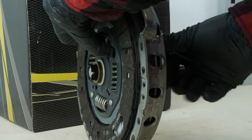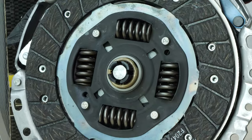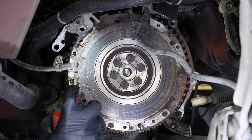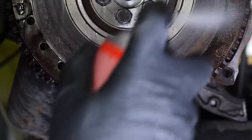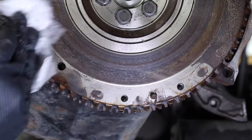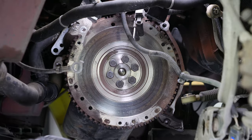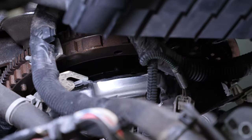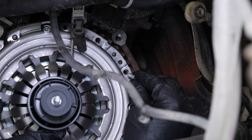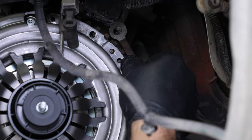Once the tool is properly installed, check that the disc and housing are perfectly aligned. If this is not the case, you will not be able to insert the transmission shaft into the clutch disc when fitting the clutch housing. Clean the contact surface of the flywheel with some brake cleaner and a cloth. You can see the three centering pins for fitting the clutch to the flywheel. Take the newly assembled part and install it on the flywheel. We strongly advise you to install brand new clutch screws — you can find them in the description. Roughly replace the screws by hand.